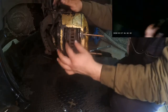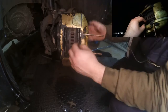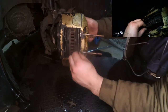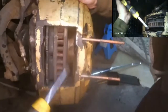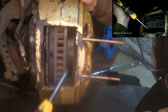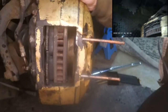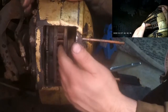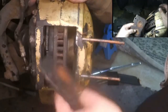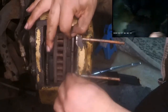Now if you're replacing your pads with new ones, you'll probably find that the old ones are worn. What happens with worn pads is that the caliper pistons stick out. What you need to do is push the caliper pistons back in — to do that you have an extra bit of work, so I'm going to show you how to do that as well.